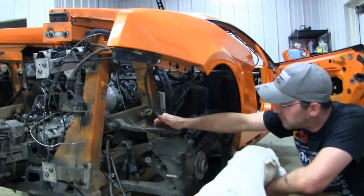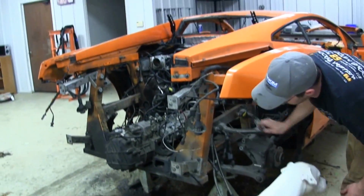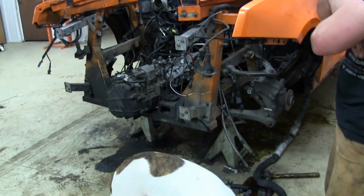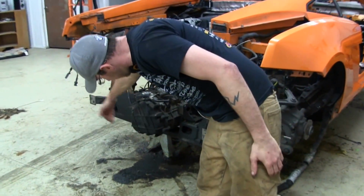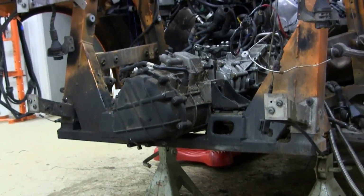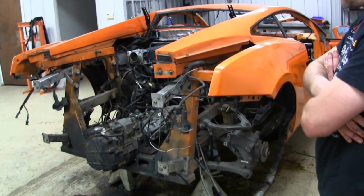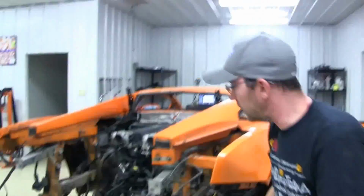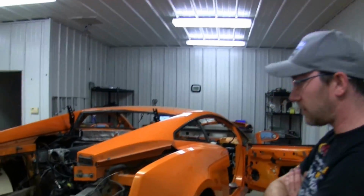Okay, perfect. In the back here, what are we going to do to protect the drivetrain sticking out the rear? A 1/4 inch aluminum skid plate from the back and kind of a cage around it, out around here and up over the bottom, just to keep rock impacts and anything else that may occur if you do go into the woods backwards. Alright, so we'll probably just make some sort of a DOM tube cage coming off the rear of the chassis there, just strap it on the back, bolt it on where these bumper mounts and everything are, integrated into that, since we can't really weld the aluminum chassis to anything steel anyway.